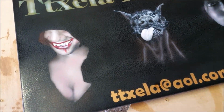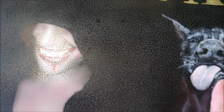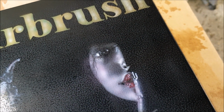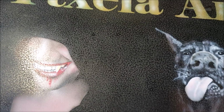Well, there we go. That's all the flattening out I dare do with that paper. And again, I'm showing the light on it, so I'm making it look as bad as possible. You can see what that's done is flattened out the orange peel effect. It does feel really smooth when you run your finger over it, but everywhere it's that whiter colour is a lower spot. Now, I do know from experience doing it with the aerosol cans, if I was to go over this with the cutting polish and then polish it up with the car polish, it wouldn't look too bad. It would take most of that out.